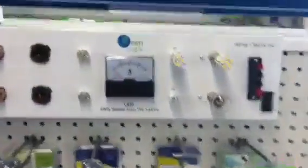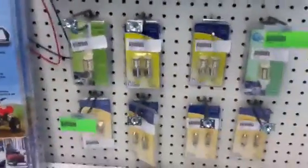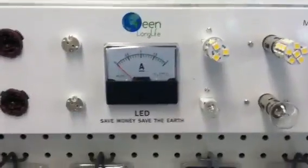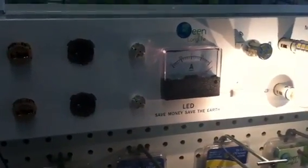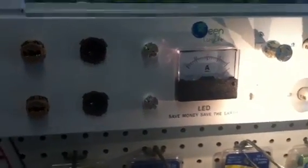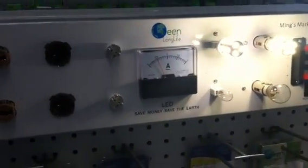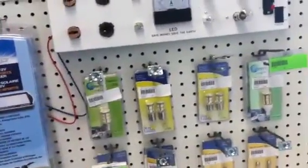You might eventually think about going and changing your lights on the inside to LEDs. Most of your lights on the inside are going to run what they call a 1141 bulb. I've got a little display here that kind of shows the difference. These are your standard bulbs here — I'll just blind us a little bit. You'll notice the needle on that went to about 2.5 amps. Same bulbs in LED: a lot better light, about 0.5 amps. These do get a little bit expensive — most of these are running about $25 a two-pack.